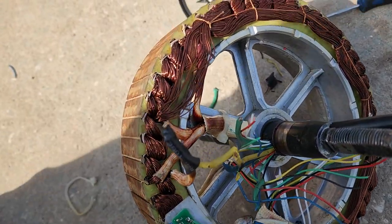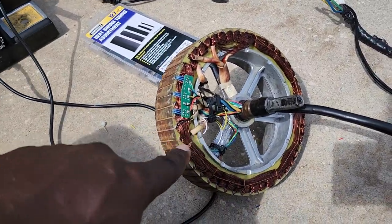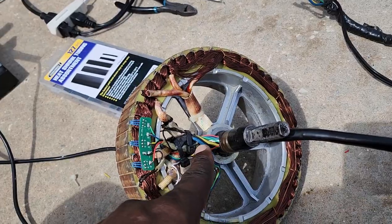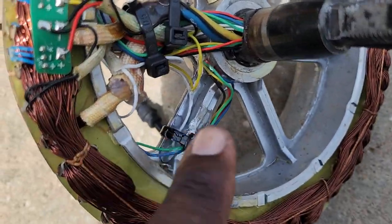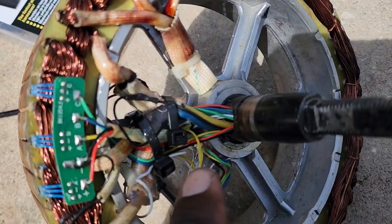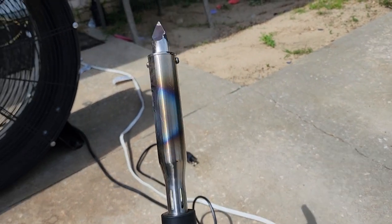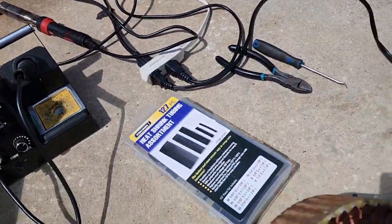The phase wires we already know where to go, and I'd say about an hour we should have this bike back on the road. Alright guys, I got it all fixed up. Hopefully this will work — hopefully the controller isn't shorted out because of that bolt that was spinning and cutting up the phase cables. I got hot glue on most of the stuff because this motor has two hall sensors and two separate hall sensor wire sets, so we're not using the other set. We did a continuity test to match up the hall sensor wires.